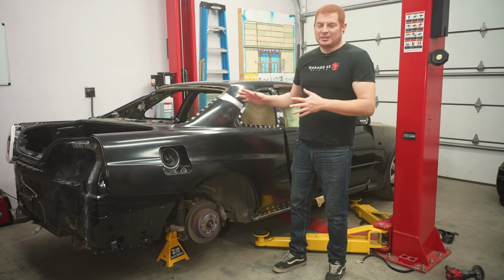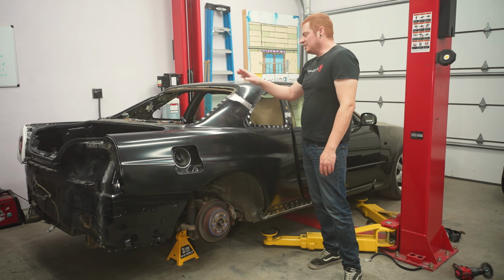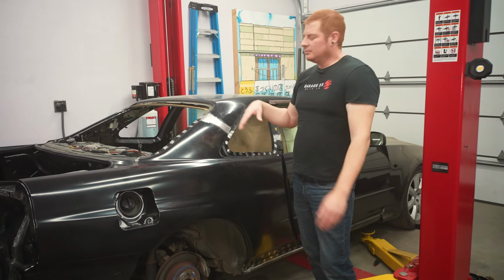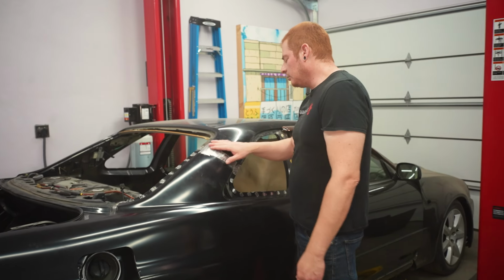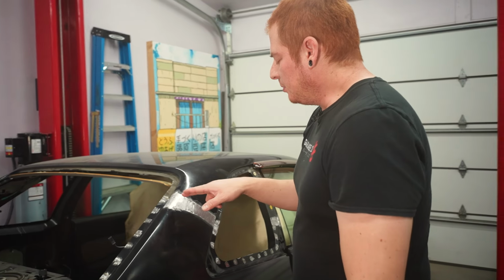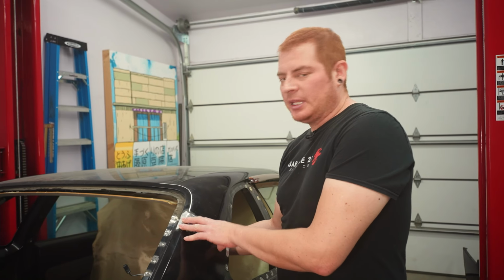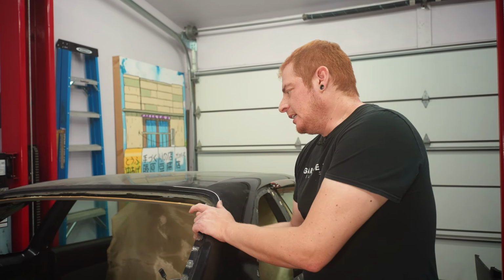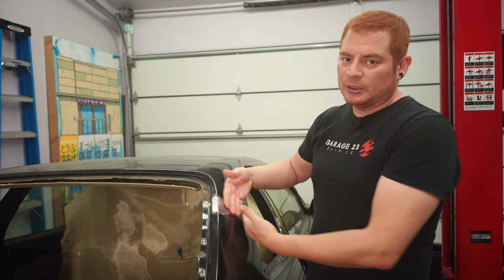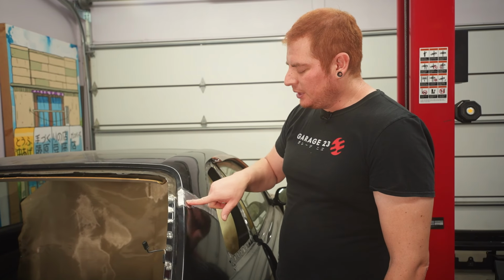All right, I think we're done welding, and I finally got this to the spot that I'm happy with. We ended up with a little bit of a low spot here, and I resorted to trying filling it with weld, which didn't go very well, but I think it's still gonna work out, because you kind of want a little bit of a low spot to fill it in with glazing putty. So I think it's still gonna be fine, but what I should have done was probably try and support the backing plate that we made from the backside, because I forgot that on that side I had shoved a screwdriver and lodged it to where it would push the plate up even with both panels. I didn't do that on this side, and it kind of fell back a little bit on this edge.